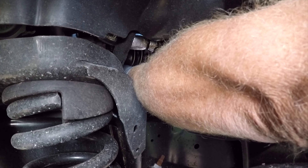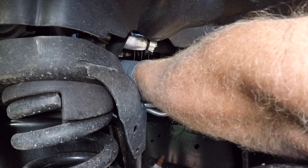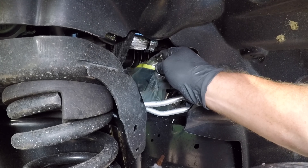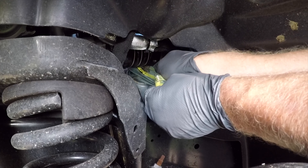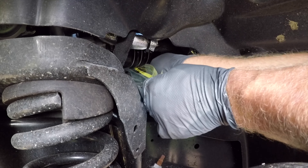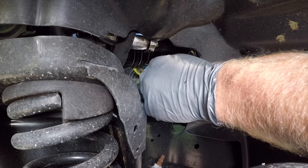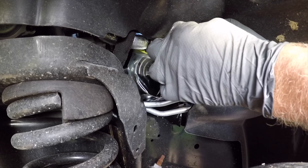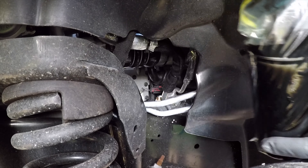There is a way to get the oil filter off, but you need to remove a lot of stuff on top of the engine. I found this to be the easiest way — just put it in the Ziploc bag. Keep the top of the Ziploc bag a little bit higher than the rest of the oil filter and the oil will spill out into your bag. Make sure you don't rip the Ziploc bag as it comes out, and gently pull out the bag — there it is with no oil spilled.